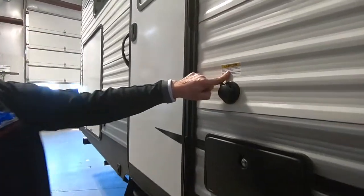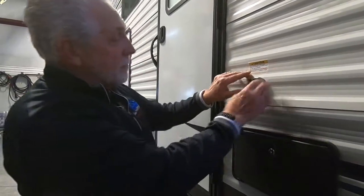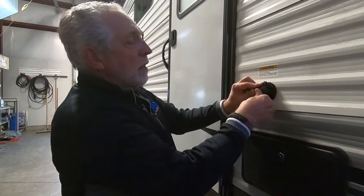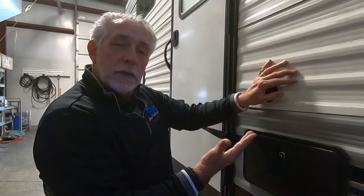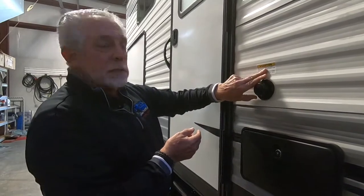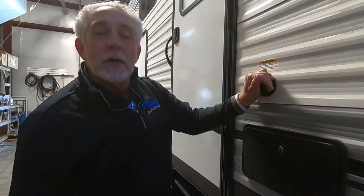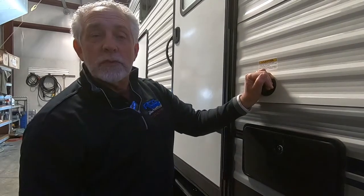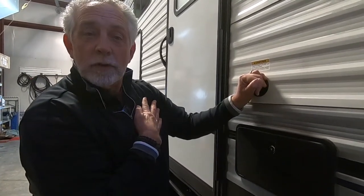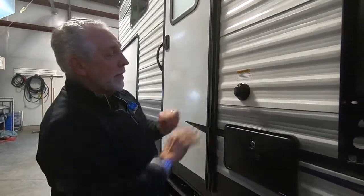This has a caution sign on it. This is an access to put a water hose up to it — it threads on, you turn the water on and it goes into your black tank with pressure and a whirlpool action to rinse everything out. The reason there's a caution sign is you do not want to turn this water on unless the black tank drain is open, because if it can't get out the drain, it's coming right back up inside your camper. That causes heartache, and I've never talked to anyone who forgot more than once. Only thing on here that will cause you that kind of heartache.